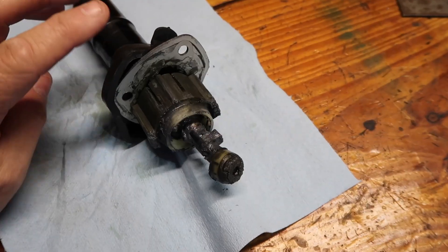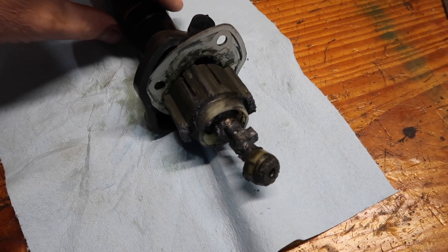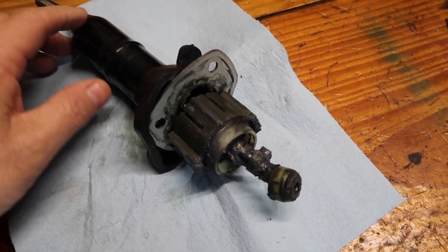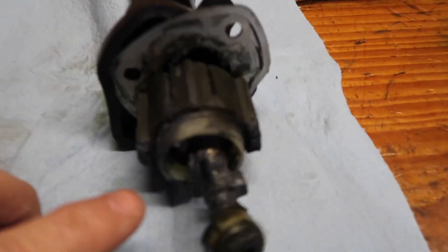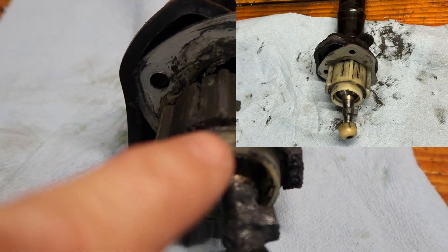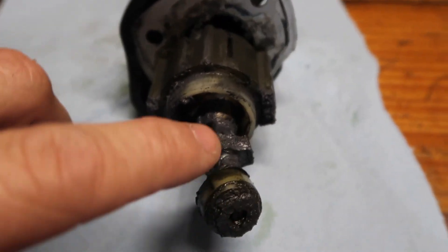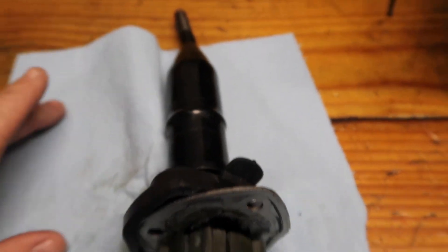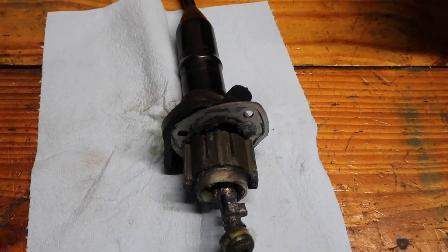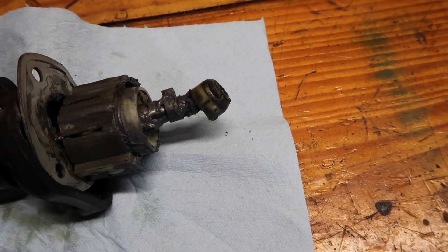See what it looks like under there. Somebody asked me how to replace this because I glossed over it — I did do a full shifter rebuild video. The first thing I always tell you is take a picture of it when you get it out. Note that this little raised piece here — note which direction that goes in relation to this square right here and the angle of the shifter. Take a couple of pictures and make a diagram so you don't have to do it twice.